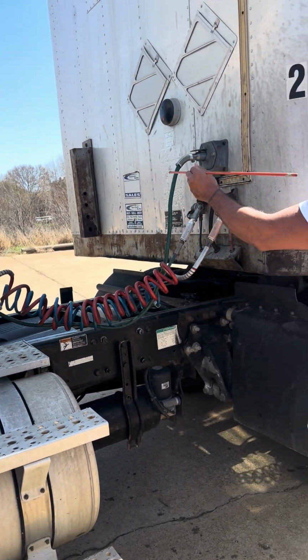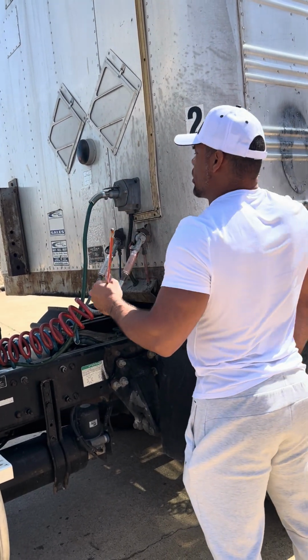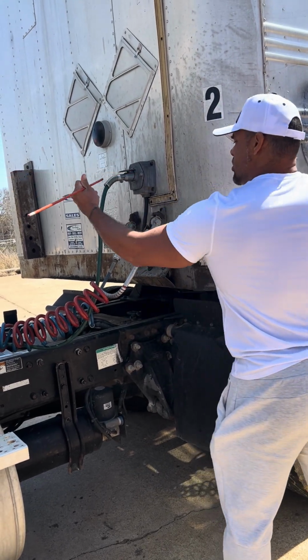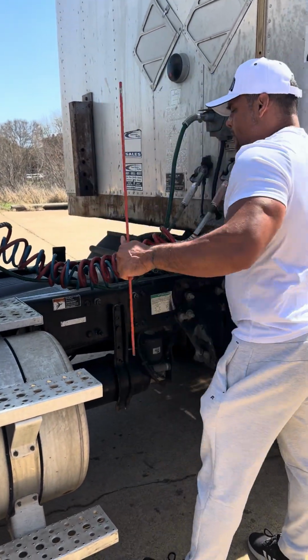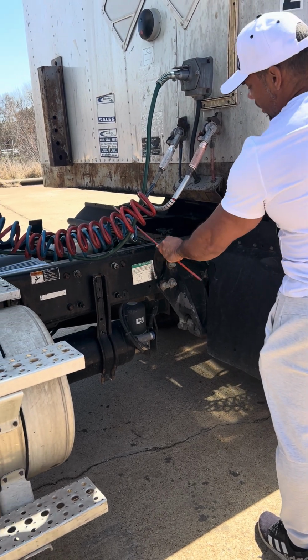I have my 7-pin electrical line, which is properly mounted, secured, not bent, broken, or cracked. All nuts and bolts are present and tight. It's in the lock position. There's no exposed wiring. It is also not rubbing across the frame. The frame is properly mounted, secured. It's not bent, broken, or cracked. All nuts and bolts are present and tight, and there's no illegal welds.